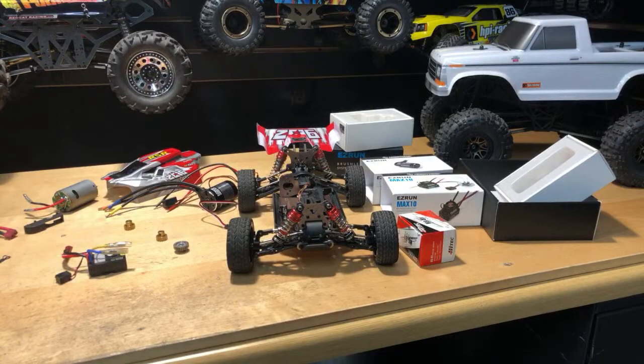Yeah, I think the clawback is a little bit on the fragile side with some of that stuff, depending on the power. Because you're turning those big meats, those 8-inch rims or tires, it puts a lot on those little pins for sure. Even the drive shaft, I snapped mine on just under the amount of torque the motors are putting out. So that's why I don't want to go any faster with my clawback.